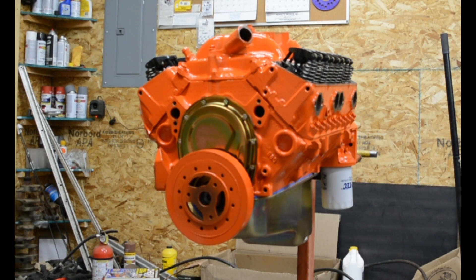I'm trying to make this thing look like it belongs in an early Chevy. I didn't want it to be black or have center bolt valve covers, anything like that — nothing wrong with those things, I just want it to fit the truck since everything on the truck is vintage. I used a GM marine high-rise cast iron intake manifold. They say it's a copy of the old LT1 Z28 manifold, and it's close, but it also has accommodations for a spread bore carburetor and dual bolt pattern.